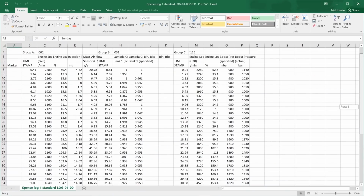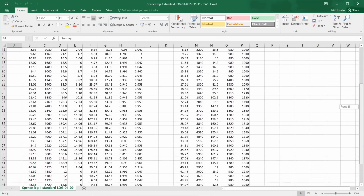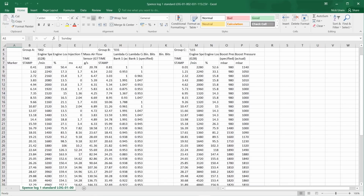Yeah, that's it, good. There we go, so 100% throttle pedal all through, jumps into the 0.953 table, that's following it nicely. Fueling looks good, load looks good. Boost in and around the 0.8 of a bar, which is completely standard. Happy with that. Alright, let's have a look at the airflow.